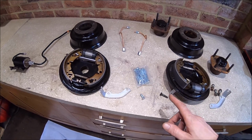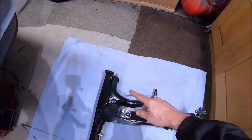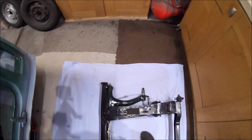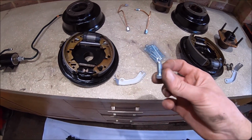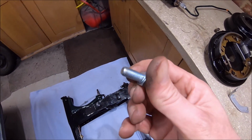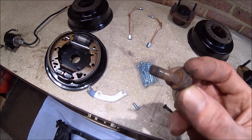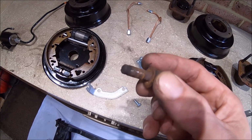So I actually bought a second bolt pack. These are the ones for the subframe mountings, and I bought a bolt pack for the radius arm brackets. So you get 4 bolts, that's a new one in there. And there's one of the new ones there. But what I found, now this may be perfectly okay using them when you're going on a brand new subframe. But on this one, the bolts that came out were horrendous. Let me just grab one. So there's one of the ones that's come out, and as you can see, the thread is almost ripped off of that, just where it was corroded.